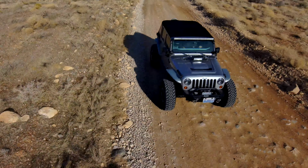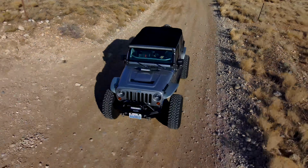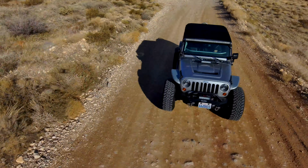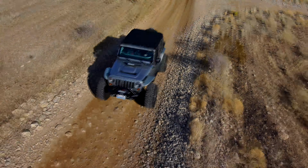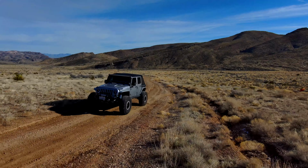racing and everywhere else. However, the L99, its variable valve timing counterpart, is really an excellent engine. It allows you to run a slightly bigger cam and still maintain a good idle. If you want the fewest amount of parts that can possibly break in a competition situation, then get the LS3. We're going to be talking about the cost of the 6.2 LS swap today. So let me give you a quick rundown on the LS 6.2s that we have used.